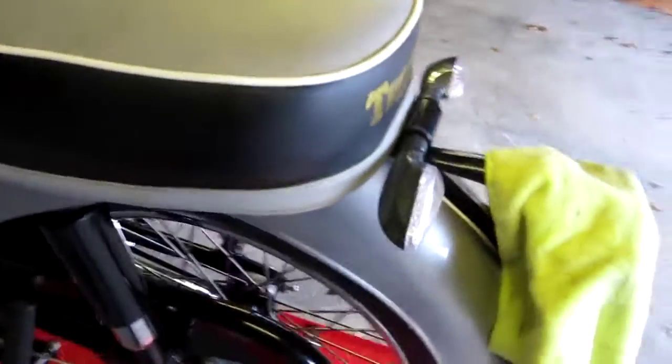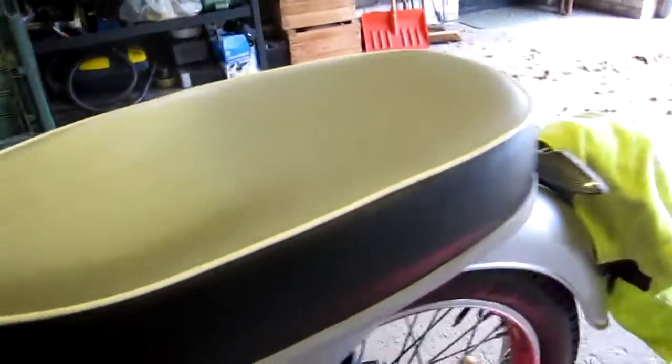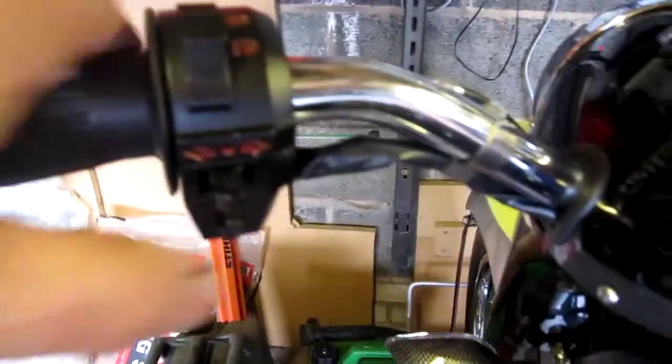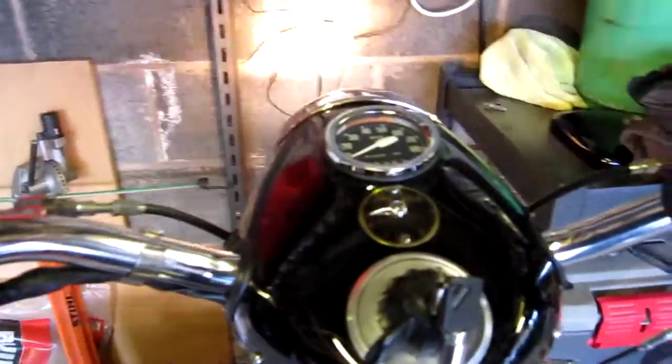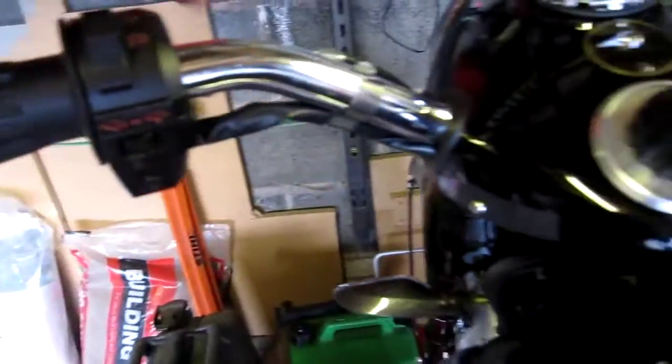What I used for wiring is cat cable — very low voltage. Brought it under the seat, under the tank and brought it to the nacelle at the front — combined switch, headlight, horn, everything. Made it very neat, took all the wiring underneath as you can see.